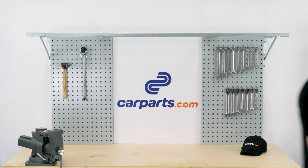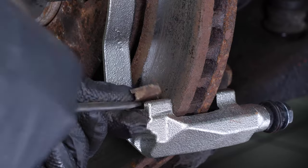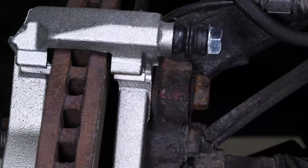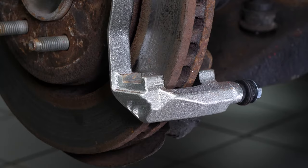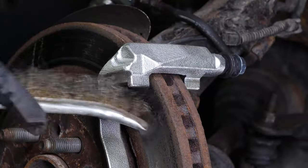It's Alex from CarParts.com. If you enjoyed this video and want to support us, like, comment, and subscribe. Using a flathead screwdriver, remove the anti-rattle clips. CarParts.com also recommends replacing the anti-rattle clips with new ones. Get hold of the anti-rattle clips supplied in the kit, and brush the caliper mount around the pads to remove any extra rust that could prevent the pads from sliding.